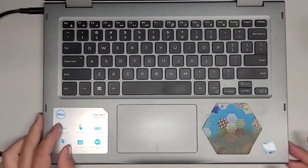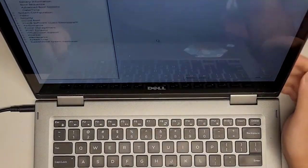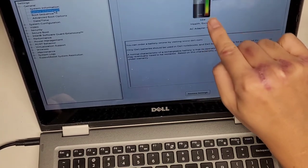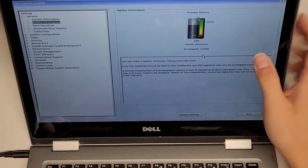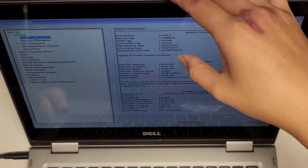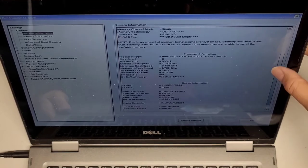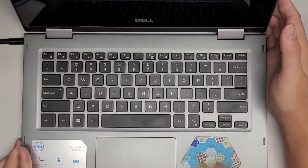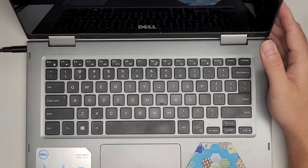What you want to do to make sure everything's working okay: power it up, press F2 to get into the BIOS. It's turning on now. Let's go ahead and make sure it boots up completely to Windows and we should be good to go. I did clone the hard drive to the SSD. It is booting — we should be good to go. We're going to let it finish booting completely and then we'll consider this completed.